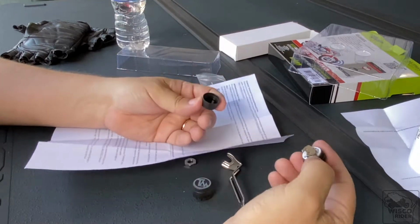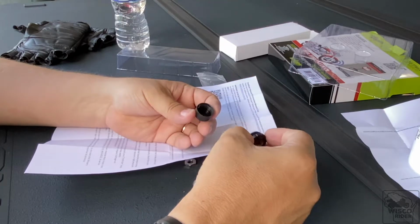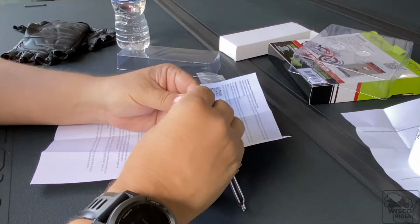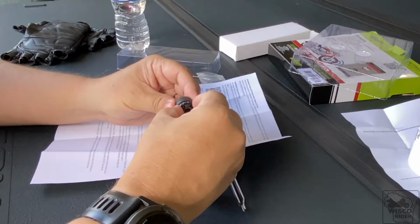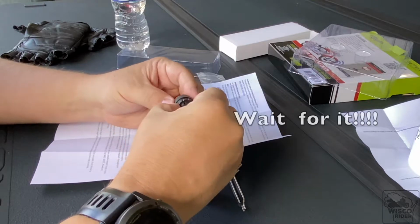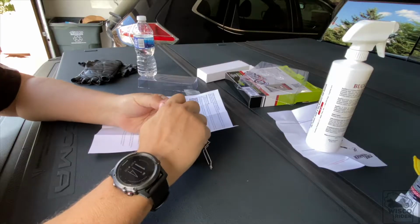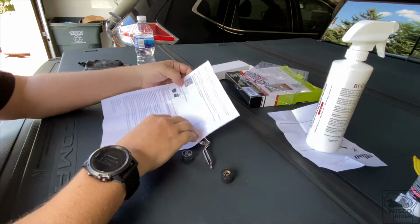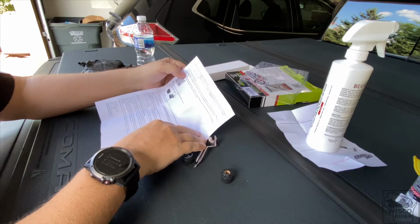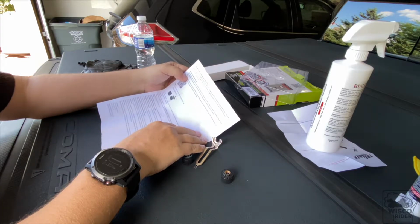I'm so glad I looked at that. I guess I will go and get some batteries because it doesn't come with any. By the way, it says, important, do not skip this step. Air up your tires to your normal running baseline pressure. If you're not sure what that is, contact your dealer. It will automatically set your baseline pressure once the transmitters are attached.